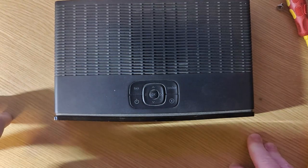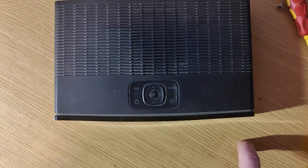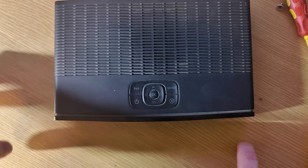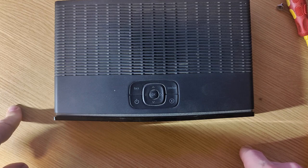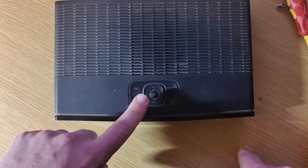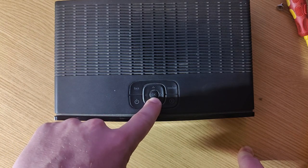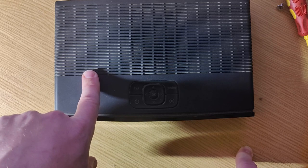When you plug the box back in, it's not going to like it straight away. If you're lucky, it will pop up with a display on screen — you just select full reset, delete recordings, and it should set the hard drive up again. If it doesn't, when you power the device on from the back switch, press the on button and hold down the down button on top — it will then pop up with the maintenance menu. Just follow the choices it gives you on screen.